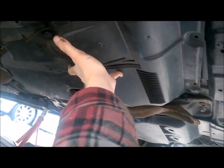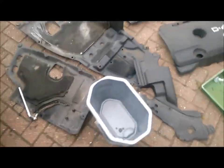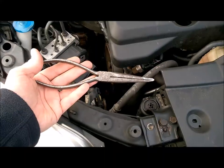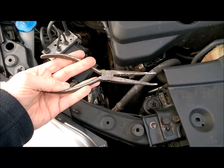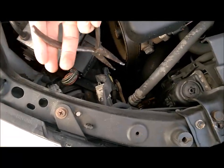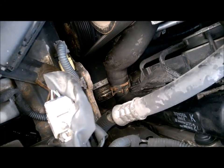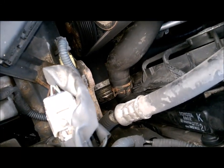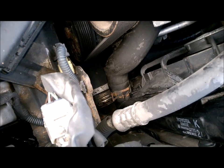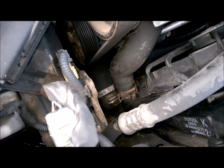Okay, now the bits are all off — just angle it a bit and there we go. We've accumulated quite a bit of plastic so far. What you need for this job is some long nose pliers so that you can get down into there. Once you've squeezed that clip with the long nose pliers, you can then take off the bottom hose and the water will come gushing out, so be ready with your trays because it goes everywhere.